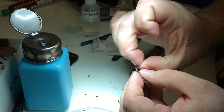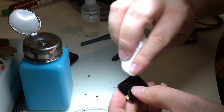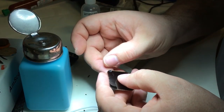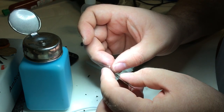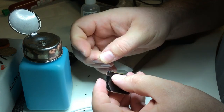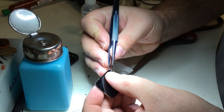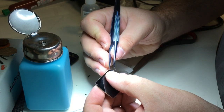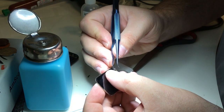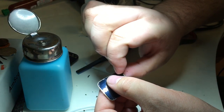And it's a good thing to have a little bit of nail here. I have longer nails than I'd normally like to have, but it helps me pick at things that I otherwise couldn't grab. And this situation is probably going to call for me to use my tweezers. As long as I'm careful and don't scratch the digitizer and carefully pick at just the shards of glass, I should be able to successfully remove that last piece of adhesive without damaging anything.